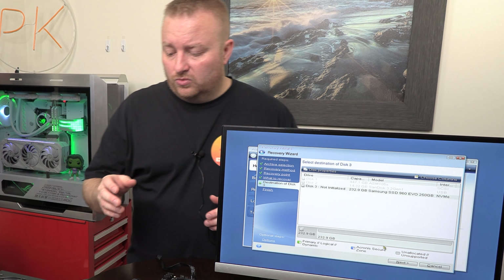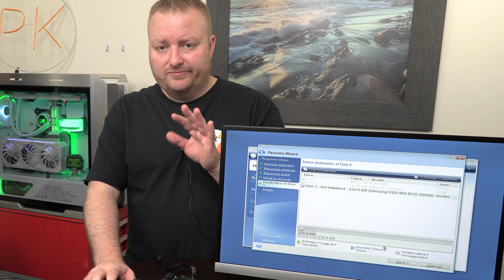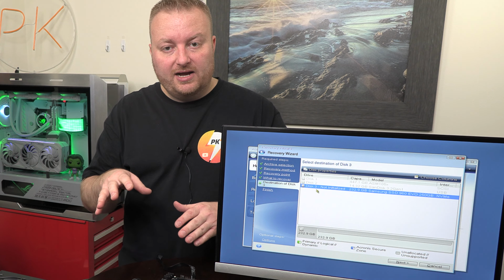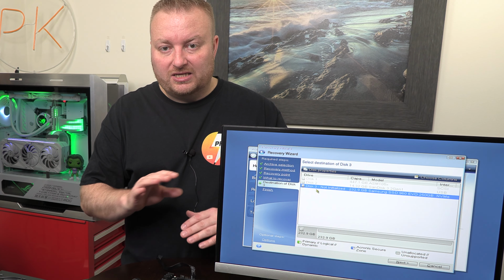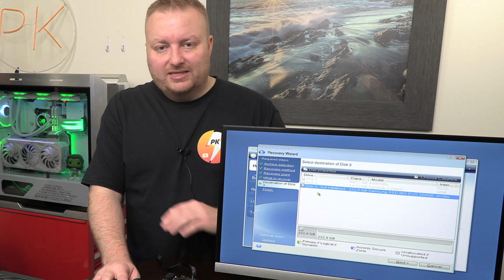Okay, so as you saw that popped up, from the time I stopped talking, it was probably another 15 seconds. And look at this. We have disk 3 not initialized. That's because when I took that one out, I put it in my She-Hulk build and I wiped it out. I actually performed a clean method on it to where it looks like it's not initialized anymore. So that's our 250 gig, even though it shows 232. There's some overhead there that it calculates and yakety yak.